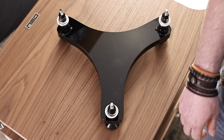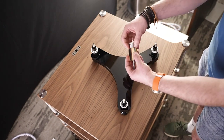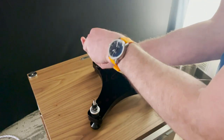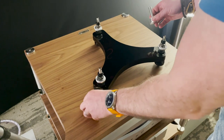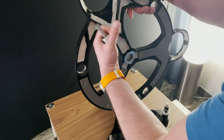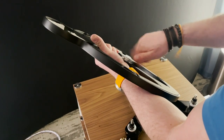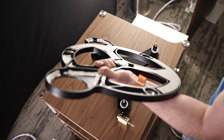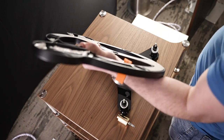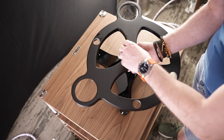We now put the chassis of the turntable in place. You'll need to fit the bearing to the chassis and then lower it into place — that's the main bearing of the turntable. Remove the spindle from the body but do it upside down; there's a small ball held in with oil that can drop out. Put the body of the bearing to one side and concentrate on the spindle. Screw the spindle in from the underside of the chassis. Once finger tight, lock it in position using a coin or a big flat-bladed screwdriver. Then put the body of the bearing back onto the bearing spindle.